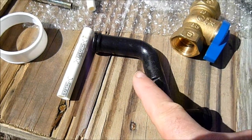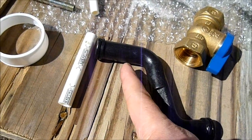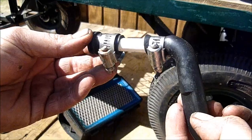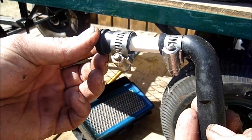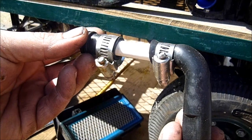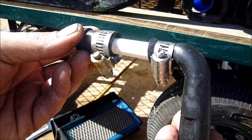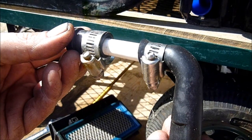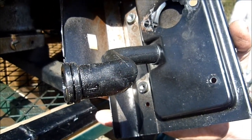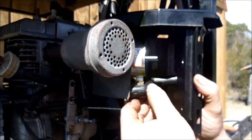If your breather tube is not long enough to reach back to the backside of the air cleaner assembly once you've installed the Venturi, you can cut the breather tube and insert an extender — you will need two hose clamps to do that. We have cut the breather tube and inserted the larger of the two included extender tubes, the little white plastic tubes, because the gap when we installed the Venturi meant the tube no longer reached from the engine to the back of the air cleaner plate. We've attached the breather tube to the back of the air cleaner assembly and we're going to put the air cleaner assembly back on the new studs.